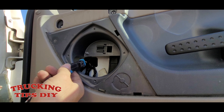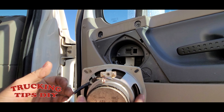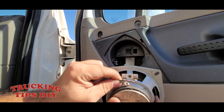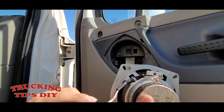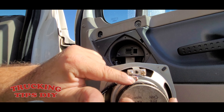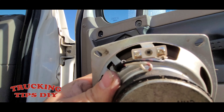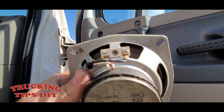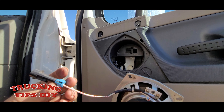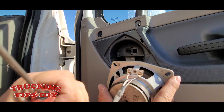You're gonna have this plug right here — all you gotta do is lift the tab and pull it out. I'm gonna be removing this plug and connecting it to the new speakers. Before you cut the wires, make sure you check where the positive is. The positive is going to be the white cable and the negative is gonna be the black one.